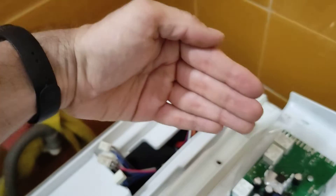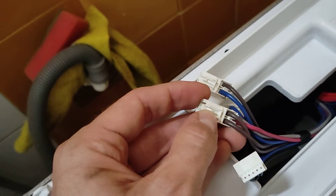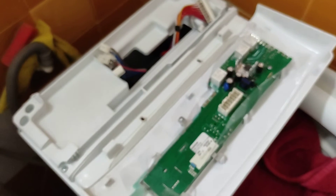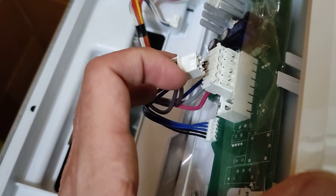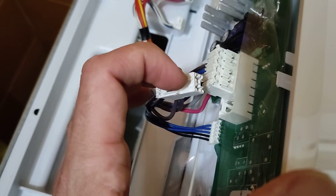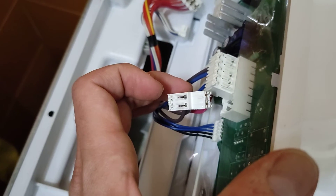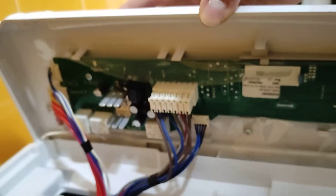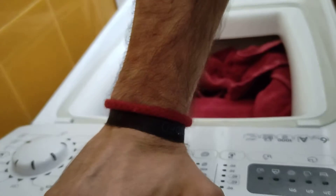These simply slide on and slide off. These ones here do require a bit of a push with a screwdriver into the pin and they are very stiff to get out, but don't be afraid to pull them — and try not to cut your thumb like I did. One small but clever detail to note is the way that the electricians have keyed these pins. There are four pins but only one is keyed, so this key is different to the others and they cannot be put in incorrectly. Once those have been reconnected, we can simply push this panel back down into place.